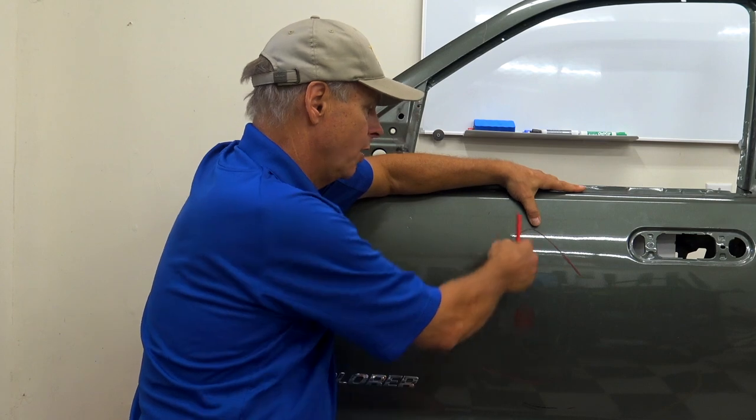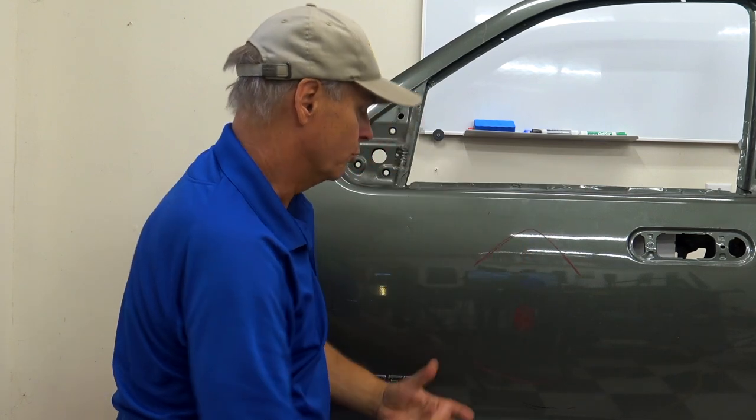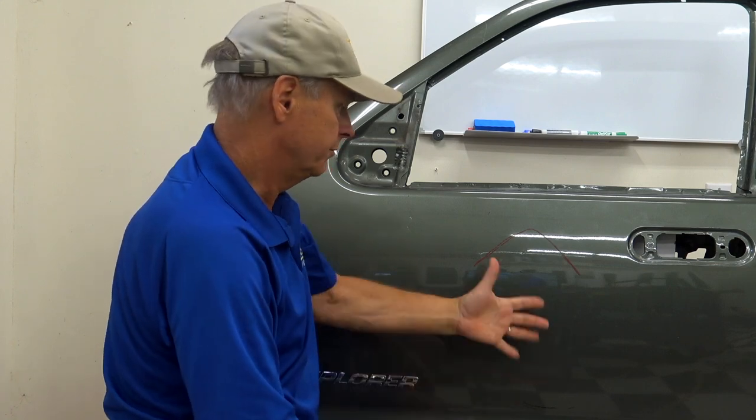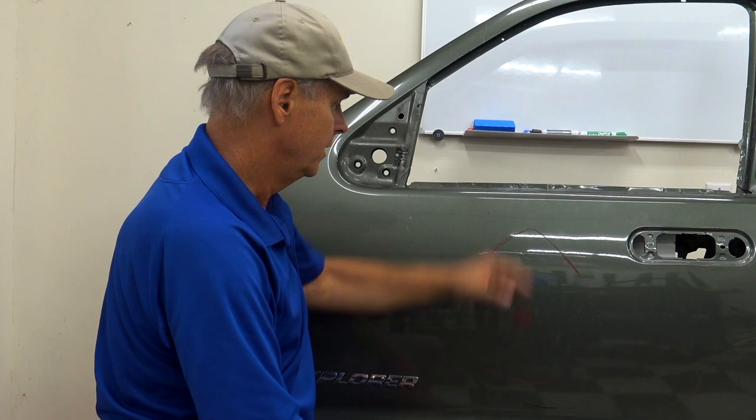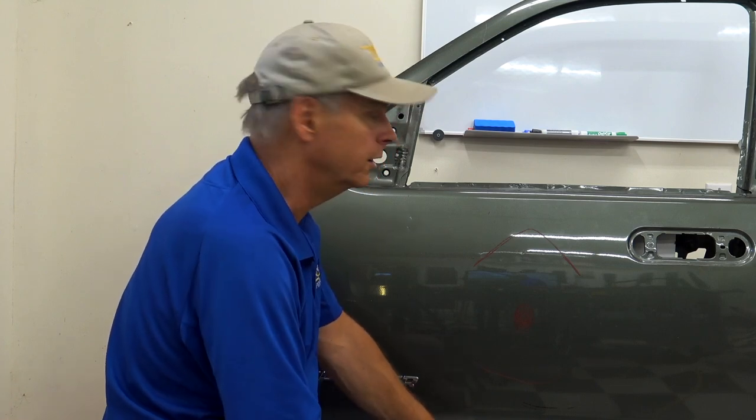Okay, and like we said, most of our energy is here. Like we also said, most guys would push on that impact point to move it because they get instant gratification. They do that, the crown looks like it comes out, sort of, kind of. And they get about 60% of their dent, maybe 70% of the dent pops out. And they think, wow, I'm rocking.